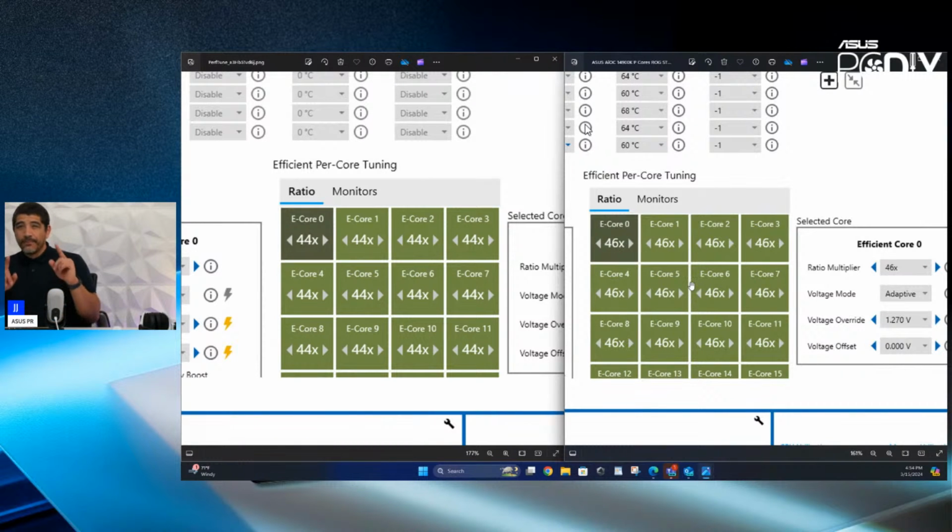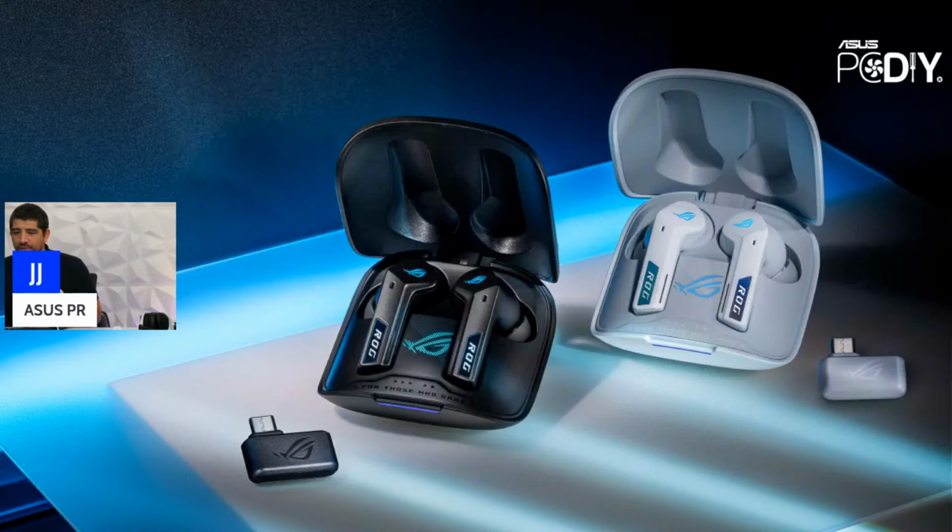And critically, the other really cool part is that the ASUS AIOC leverages an adaptive voltage. So when the system is idling, voltage and frequency come down, and you're only seeing that increase in frequency and that supplemental increase in voltage when you're going to the higher OC-centric values. So overall, pretty cool addition. So props to Stuart. Thanks for showing those ASUS AIOC results, man. You killed it with another amazing build.